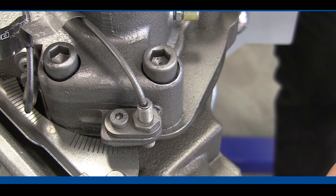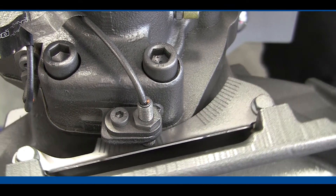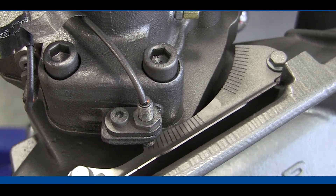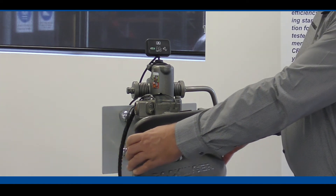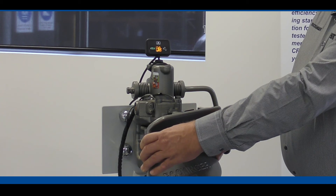This third sensor, located here, is looking at the coupling mouth itself. So when the coupling articulates and gets around to those angles where it's going to damage the trailer drawbar, you'll see a warning light go off on your dash display to warn the driver that it's time to stop before they do potential damage.